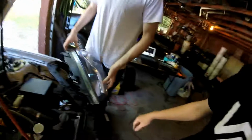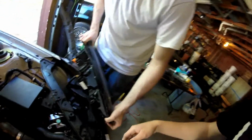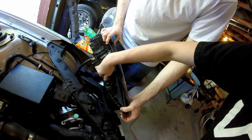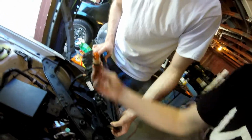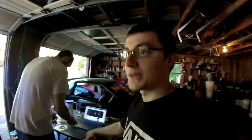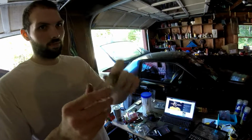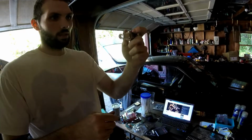That easy. So when you can flip it over, you don't have to unplug the main power, but the turn signals are right in here. And it's just a twist and pull. And the old one is out. So the only thing holding the bulb in the socket is like a push down and half twist. And it only goes in one way, correct? Yep, only goes in one way. And twist. There you go.